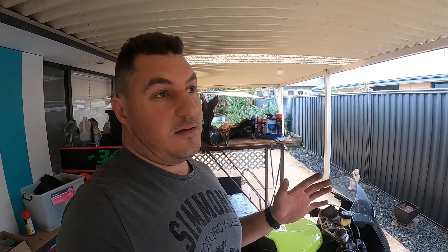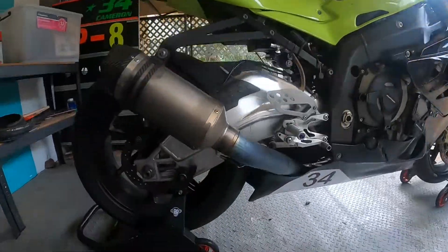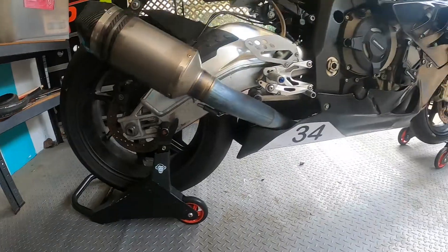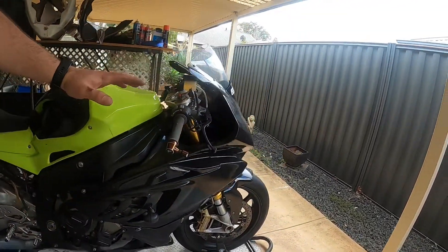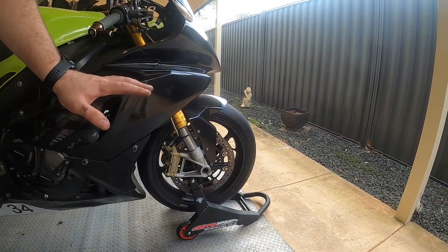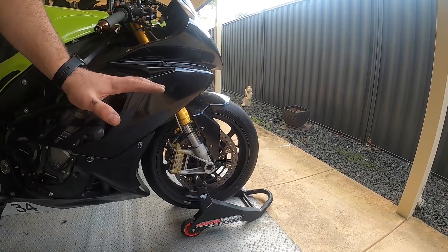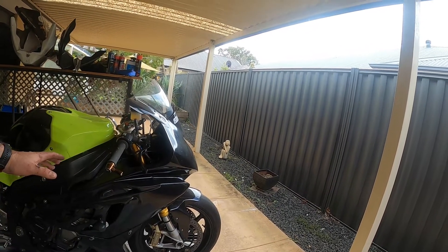The other thing we found was the fork. When I'm riding, my front wheel doesn't seem to dig in quite as hard as I was used to with my old ZX10 — it always felt a little bit light on the front end. Now this bike is set up very long already; it's right at the back of the stops on the rear end, the shock is a bit on the long side, so it is already raked forward a bit. It should be set up in a way that it turns nicely and has a lot of weight on the front wheel, so I would expect it to dig in a lot more than it currently does.